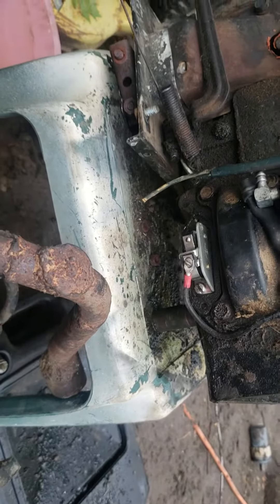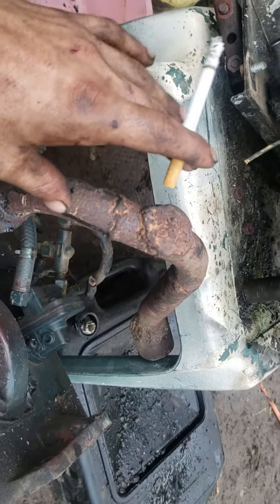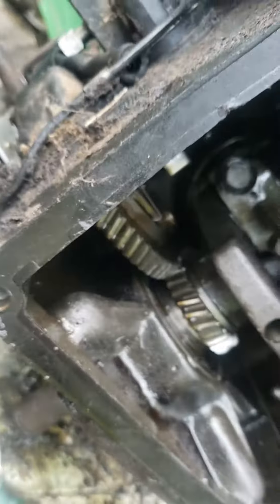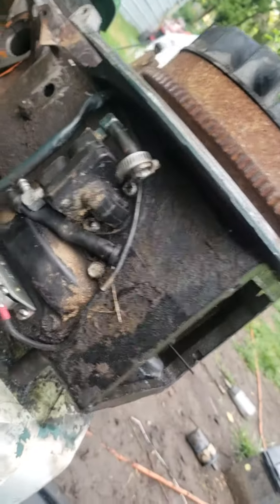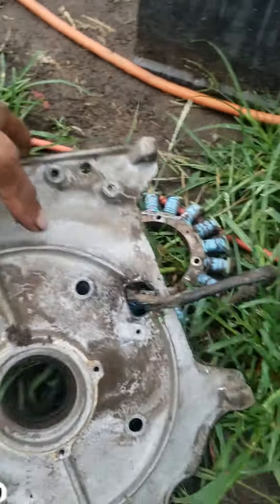This one was already points-ran, so what I went through and did was basically just reset the timing. The top plate off of this motor I switched onto this one.